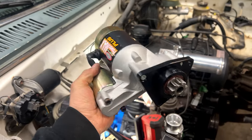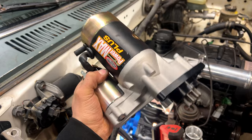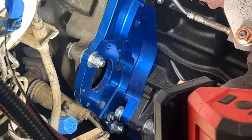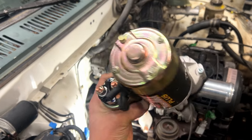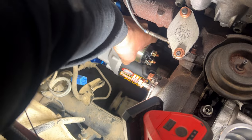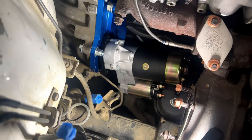This feels like just the episode of dilemmas. Here's the starter — I'm just knocking off random stuff we can do while waiting for parts. It's a bit funky — it's got two mounting bolts but you can clock it in the bell housing adapter. There are two sets of bolt holes drilled there. The way I have the mount, the butt of the starter hits it in the intended orientation. If I put it in the other way, it hits that mount. That's a problem.